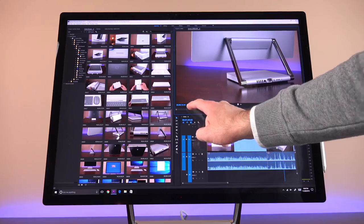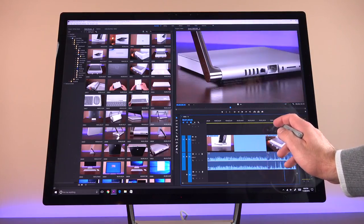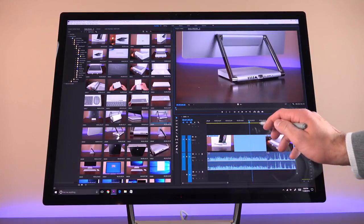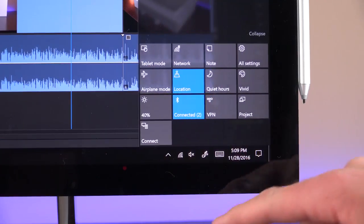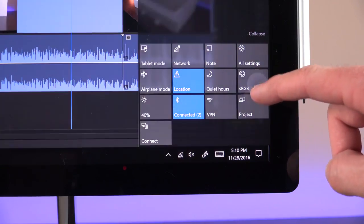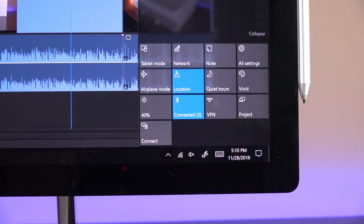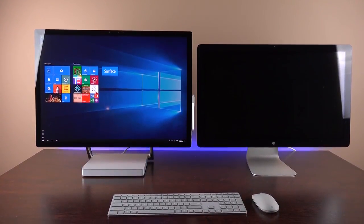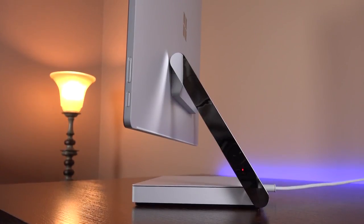It looks fantastic. This is a full touchscreen, also designed to work with the Surface Pen and Microsoft's N-trig technology. This is not a 5K display — we have a resolution of 4500 by 3000, which is better than 4K and delivers a 192 pixel density, though not quite as sharp as the 5K display on the iMac. It is calibrated to the sRGB color spectrum as well as DCI-P3, and you can toggle between these color profiles right from the control panel, which is very handy especially for photography or video. Because of this 3-by-2 aspect ratio, the screen area is quite a bit bigger than a widescreen 27-inch monitor, and it's a great aspect ratio for productivity.